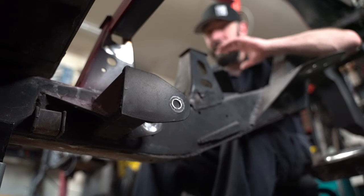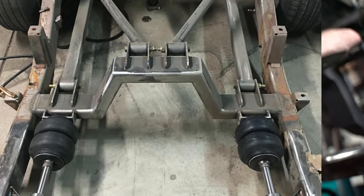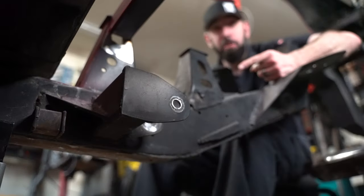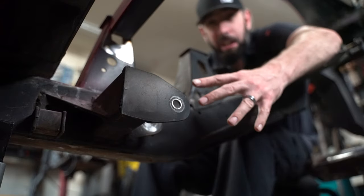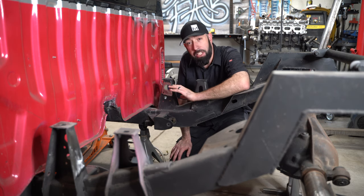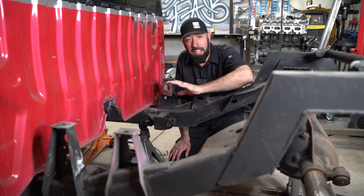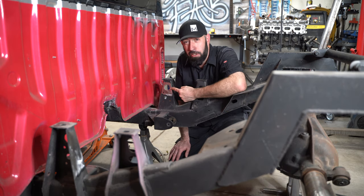Until today, on every truck I have ever built, I installed what I call a shopping cart handle — a heavy duty cross member that takes on all the pushing and pulling forces under heavy acceleration and super hard braking. The original builder of this truck didn't use a cross member. Instead, they installed lower link bar mounts that hug the inside of the frame rails and attach the upper link bars directly to the top of the bed mounts. The front bed mounts weren't ever designed to hold control arms, so when the triangulated control arms were attached to the front bed mounts, they were not only holding the front and rear forces but also stabilizing the axle left and right. So these front bed mounts were under a lot of stress. Terrible idea, right?